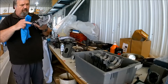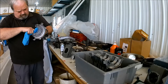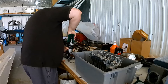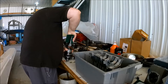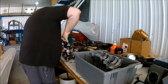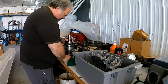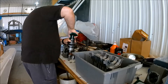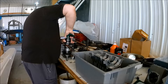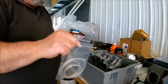I'm working in this bucket — if I drop something, I don't want it falling on the floor and rolling underneath the workbench where I'd have to hunt for a tiny little piece. I'm also cleaning up the crankcase a bit; there's some staining from the old crankcase seals, so I'm using a Scotch-Brite pad with no cleaning solution, just to scrape it down. Afterwards, I wiped it, blew it out with air, and re-lubricated those bearings before inserting new O-rings.